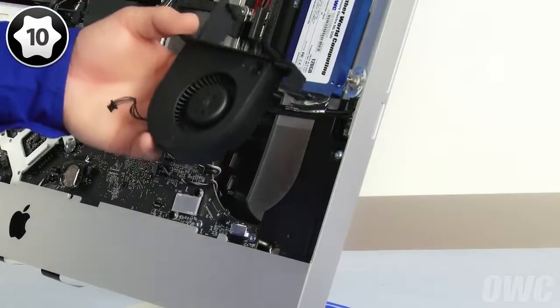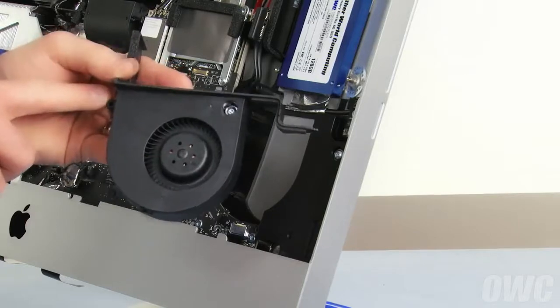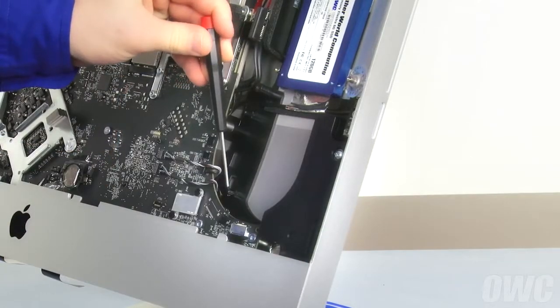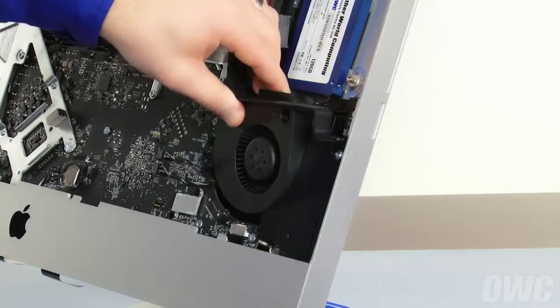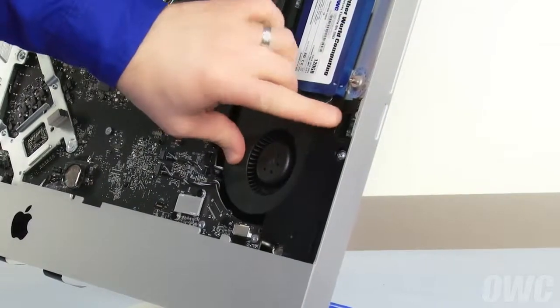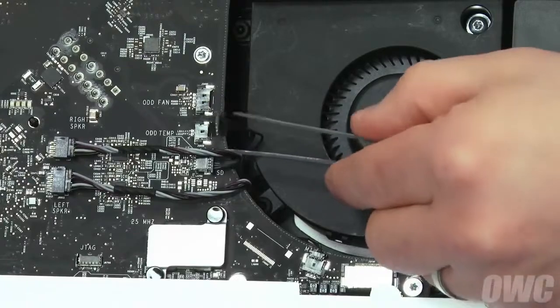You can now move the logic board up and down slightly until the rear ports are aligned. You can tell the board is set properly when you can plug and unplug all the cables easily. Once it's set correctly, tighten all the logic board screws completely. Next, we need to replace the optical drive fan. Along with the single screw, there are two peg holes. These holes line up with these two pegs. Line up the lower peg first, then the top one, and set the fan into place. Then, plug the cable into the connector marked ODD Fan.